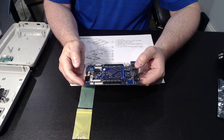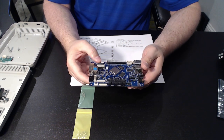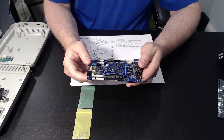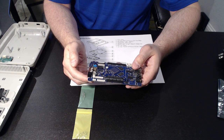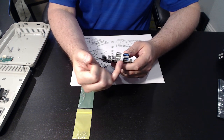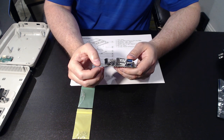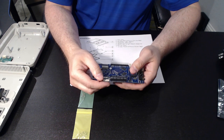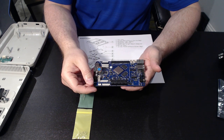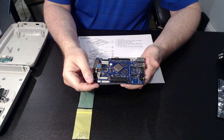The video output has HDMI 2.0 output. It has an EDP connector, an MIPI connector, a TP connector, backlight supply, and display port via USB Type-C. The USB Type-C port sits underneath the USB 3.0 port. And then we have our two USB 2.0s. We have two physical buttons here, we have our audio jack. This is your PCIe port. It also has the ability for a camera in parallel CSI and two MIPI CSIs. It has a debugging 3-pin serial header.